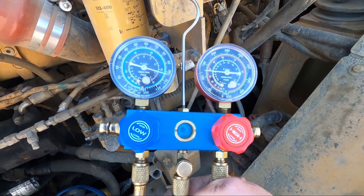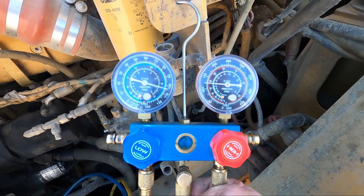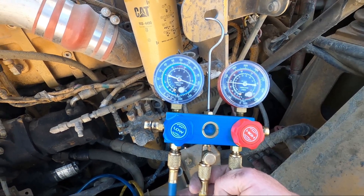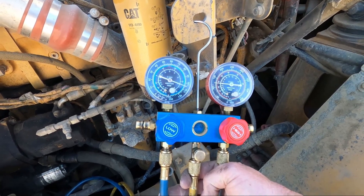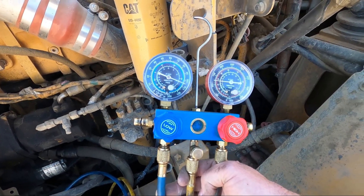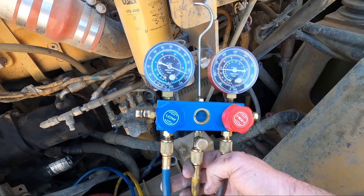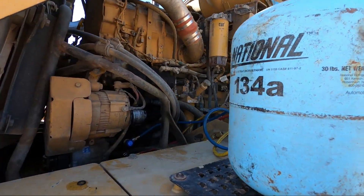I'm going to add a little bit of freon and we'll see how it lasts. If the pressure goes down again in the next couple of weeks we're going to have to investigate further. But if it stays up we're good. It could be low because it was in the 100-degree range - about 115 out here for a while - and now it's 70 to 80 degrees. R134a is very reactive to temperature: when it cools off you're going to have lower pressure. If it just makes it through this winter we're fine - it was either undercharged last time or has a very slow leak we'll probably never find.